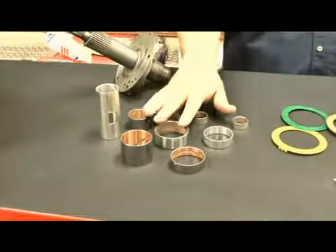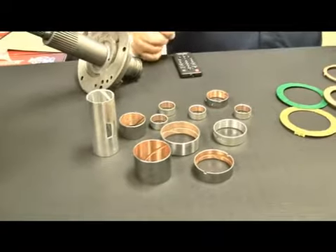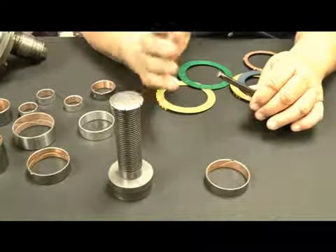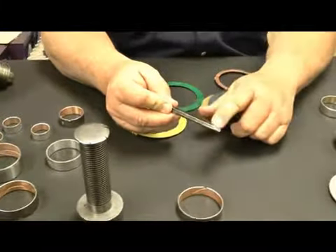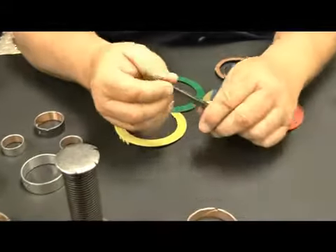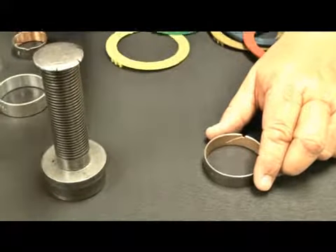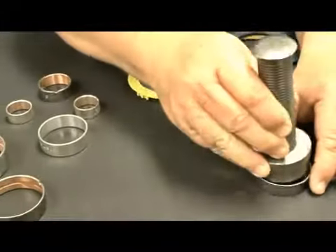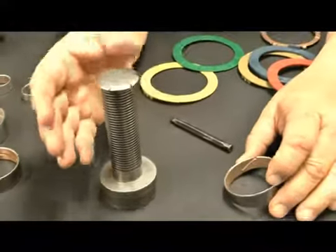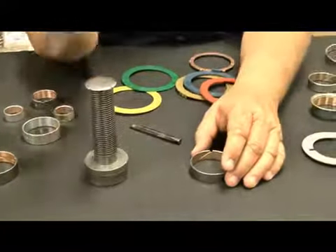So a set of bushings within a transmission is also a good idea. People often ask how to get them in and take them out. In order to remove a bushing from a drum, if you don't have the proper tools at home, it's very simple. You can either purchase what's called a cape chisel or make one yourself out of another chisel. It's an angled chisel that allows you to go down the side of the bushing, collapse it, and pull it out — the easiest way if you don't have bushing drivers. To install bushings, you really should have the proper driver fitted to the bushing. A lot of these can be found at your automotive stores, or you can buy a general kit that has a lot of different sized bushing drivers.